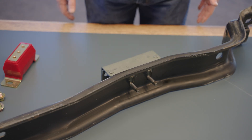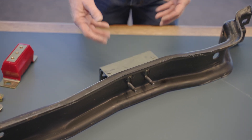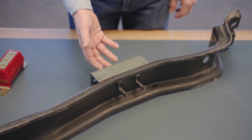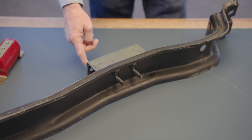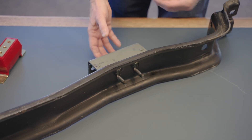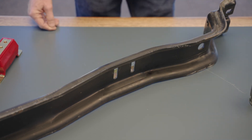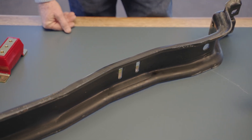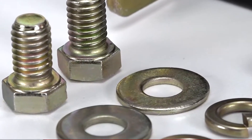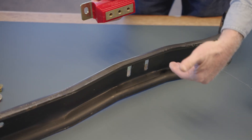This is an example of the normal installation. This is the cross member out of an F-250. We're showing the standard stock-type mount located in the position that you'll find it when you go to install it in your own vehicle. After you have removed the transmission bolts — those are generally very much the same in the Ford vehicle — you will then be able to remove the cross member from the installation. As we mentioned, the studs are there in support of the production requirements for making the vehicle on the production line. We've chosen to use bolts and washers for our installation, and this is the view you'll be looking at.